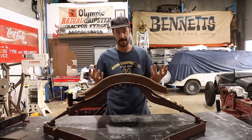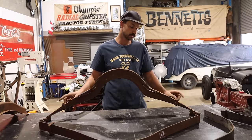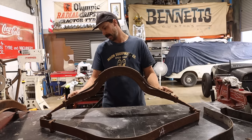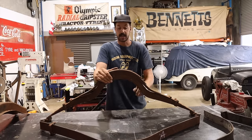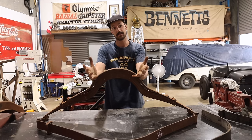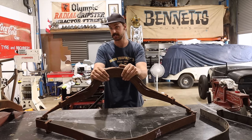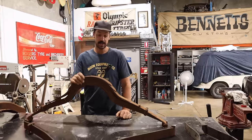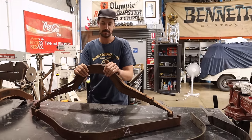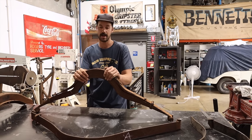So when this piece goes in we would need to make sure that it has an upper and lower plate basically made from Model A springs. We are going to remove a couple of springs as well. This wrapped one is quite cool — must be kind of like an overload spring. You want to remove a couple — whatever you think — and then when you go and put it in you basically just have to have all the weight within the car and test it out. If it's too soft, add a spring; if it's too stiff, remove a spring. So we're going to get this all removed, start removing a few springs, come up with a game plan, and then we've got to start doing some wire wheeling, rust treating, and get everything prepped. Let's get into it.